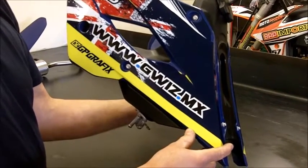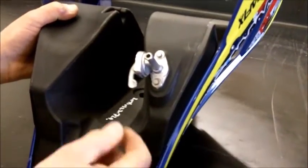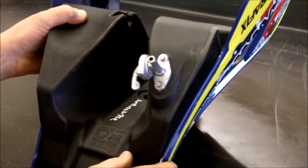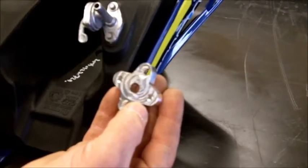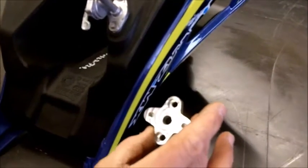The next job concerns the fuel tank and the fuel tap. As originally fitted, it hits the frame whenever you take it off, and also with the lift kit on it will foul the frame. So we need to fit this item here which will resolve the problem and give it the correct position to stop it interfering with the frame.